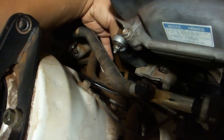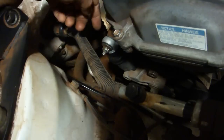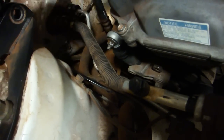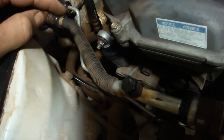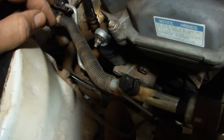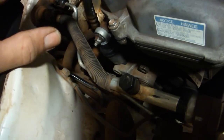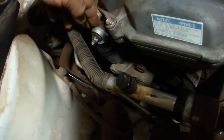I did that by removing the bolt down here and just sliding this piston off. I did the same thing with the new one and just swapped them. Now there was one special little thing that I had to do, and that was that I had no way of knowing what the torque was for the bolt that was supposed to go in here. So when I got the new tensioner, I marked the location of the bolt relative to the body, took the bolt out, and then put it back into the exact same position using a torque wrench, so that I could record how much torque it took. In other words, how much torque did it take to put the bolt back exactly the same way it was before I removed it. Then I used that same torque reading when I installed the piston into this unit.